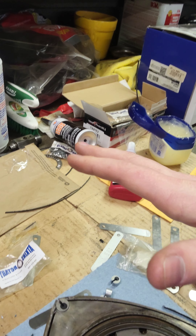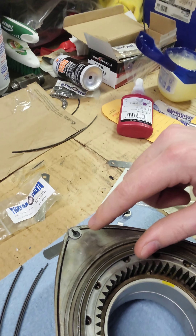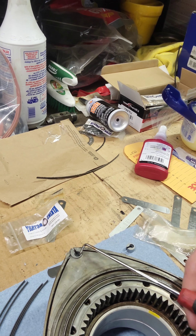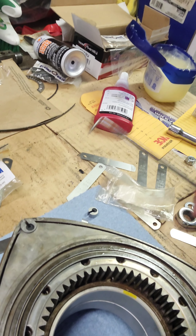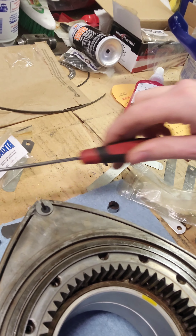I got an engine from a guy that was rebuilding them, and he must have done no gap, because the pressure against the two sides would actually snap the metal on the corner seal — right in that section. This entire outer piece of the corner seal basically became two pieces. And you don't want that because then the center piece is no longer held in by anything — they fall out, get lodged into places. Rule of thumb: don't have loose metal bits in your engine.